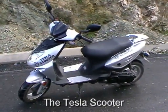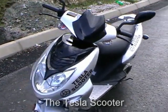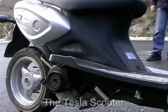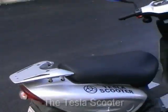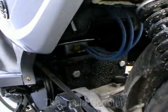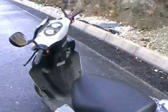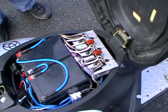This is the completed Tesla scooter. All batteries are installed. It looks like a regular scooter, but that's only deceiving because it has a three-phase AC induction motor — there is no exhaust and muffler. You can see the motor here. The pulley and belt are here, going to the reductor at the back. These are part of the battery pack and the MOSFET bank.